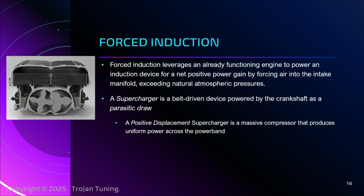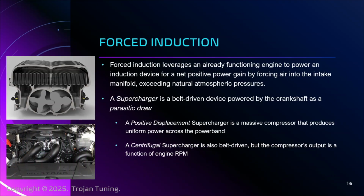And as you decrease the size of the pulley that is attached to your crankshaft assembly, this compressor spins even faster, more compression, right? And we're really off to the races here. So the analogy, if you're coming from the PC world, is this is overclocking. We're going faster than the engineer originally intended, but we can handle it because we know what we're doing and we've thought about this, and we've accounted for all the problems this is going to create. We'll talk more about that in a sec.